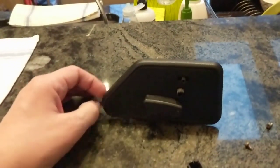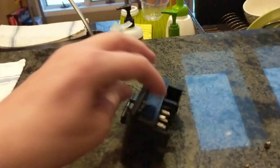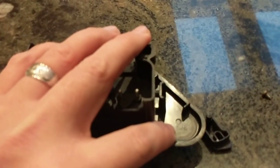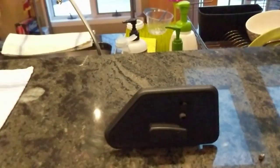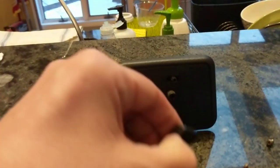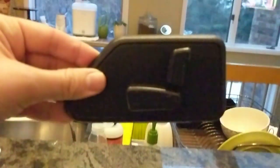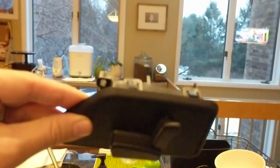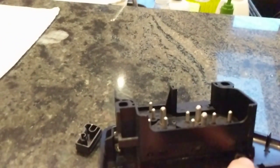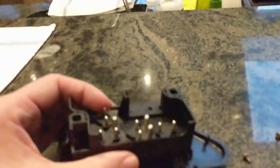So if you were sitting in the driver's side in a Discovery 1 in the United States, you're going to notice that this is considered the left hand, and it's designated as LH assembly that you'll need. I'll put on the blog the parts and everything that you need. But effectively what happens is this plastic piece eventually doesn't stick in the seat, so it just kind of hangs out because a plastic tab at the bottom breaks.